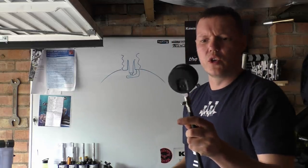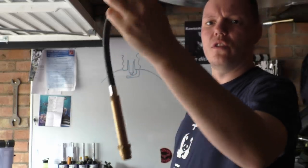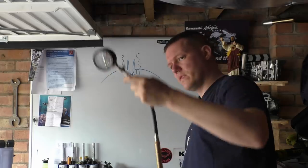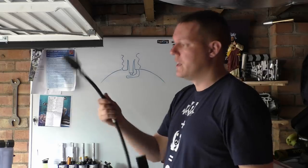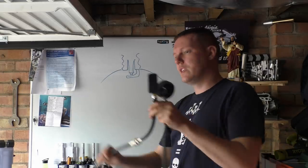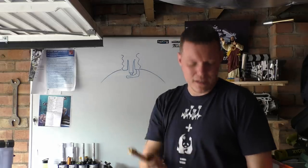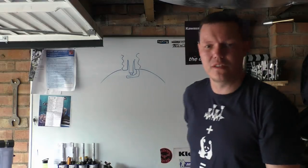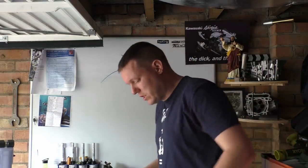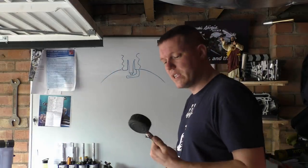This is a Gunson pressure compression gauge. It's just got a long tube and then a big brass adapter on the bottom. You can see these lines are different lengths — the OTC one is a lot bigger. I like the OTC one because it allows you to get properly in there and put the dial in a place where you can see it. The problem is they don't really sell many adapters, and places where you buy a compression tester often don't sell the right adapters, so you have to mess around. But is the volume of this affecting your test?